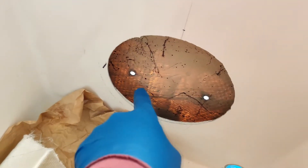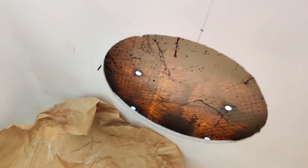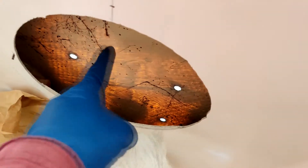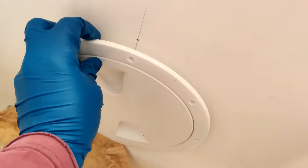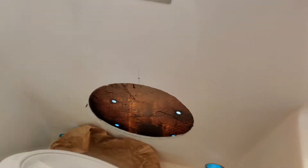I've cut a hole in the transom because this is where the motor mount pulled out. I'm gonna fiberglass this huge sheet in this whole area down here, and then I can connect the inside and the outside by taking some of these, folding them over and inserting them all the way around to reinforce this and make that all stronger. And then a really nice big port there to access so when I bolt my motor mount in I don't have to go back down in there again — because that sucked.